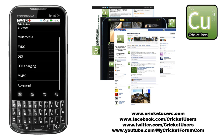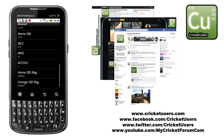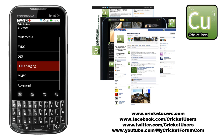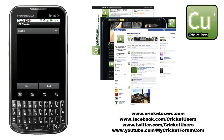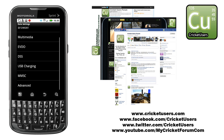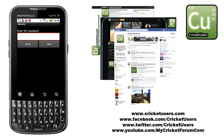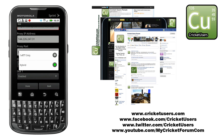Go ahead and hit back when you're done. Here we check out some of the other options in this screen. We got the MMSC and the port changed by redoing the APN and not by editing it here. In DSS, we did change the operation mode to hybrid — it was on 1X. We're not sure if this matters, but it definitely didn't hurt to change it to hybrid.